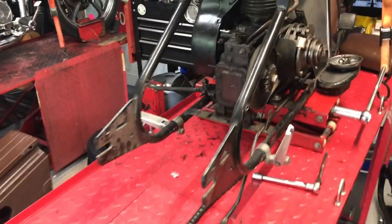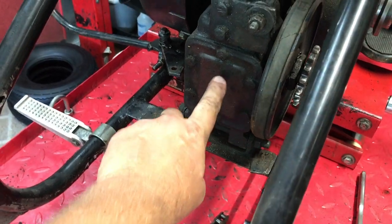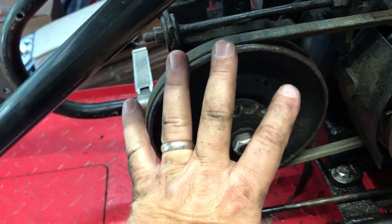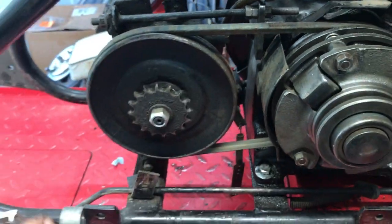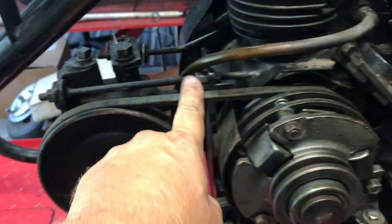We're going to be replacing the tires, but I needed to get in here to adjust and tighten this transmission and to remove the drive belt. I couldn't get the chain off the sprocket because the bottom body paneling sits right here real close, so I couldn't get that loose, so I had to remove the body paneling and take the tire off anyway to change it.